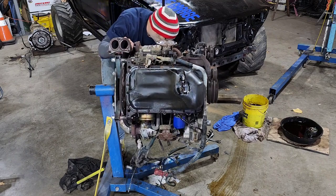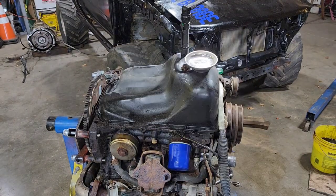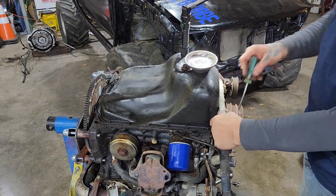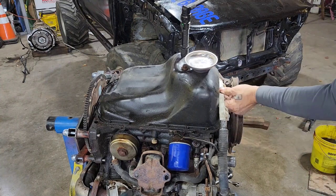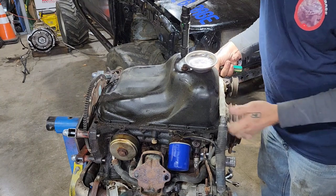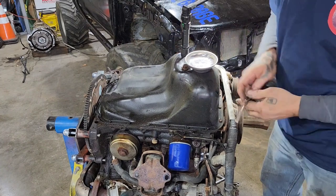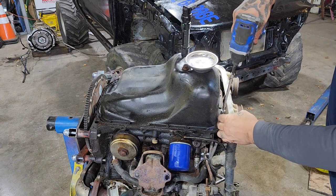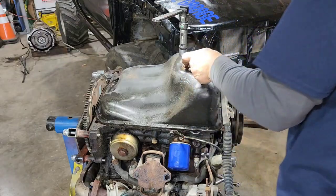It's pretty plain to see that this one's been leaking. Now you need to get this plastic piece off — it's got a couple of clips you pry out with a screwdriver and force it off. But when there's rust and crud it makes it way more difficult. I started to show you that and then I started swearing at it. You can move it out of the way without undoing the ground or your starter wires, and just start taking these off. Once you've got them all off, take a rubber mallet and buff that off.